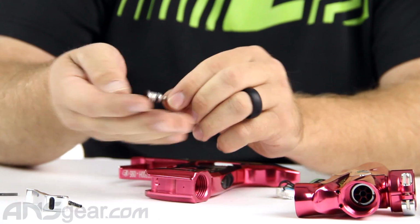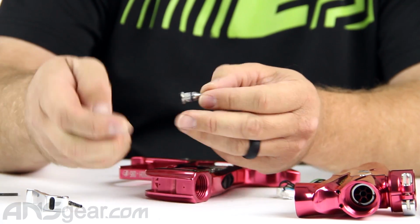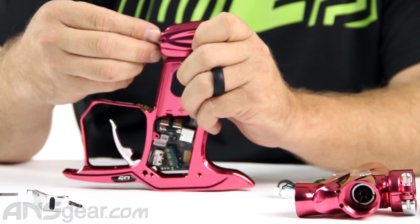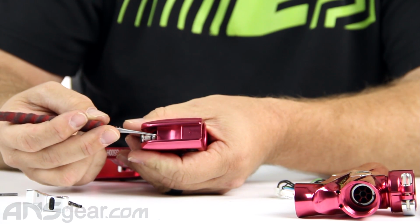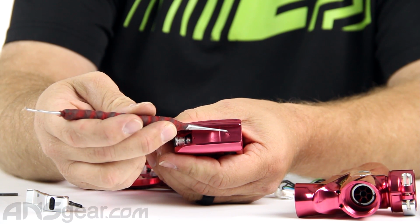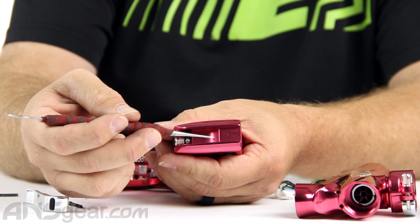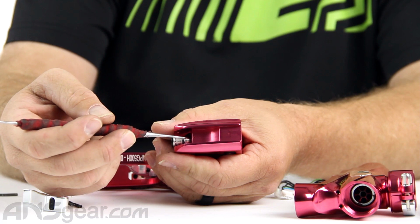That comes out. This O-ring that's on this plunger right here, these go bad. I've seen plenty of them break, but they're very simple to replace. And if you get a leak coming out the bottom of your ASA that is not from the back side right here, you can see that there's two holes. There's one tiny little hole there, and then there's one hole somewhere right there. If this one is leaking, that is the O-ring on your tank. If this one up here is leaking, it is the O-ring that is on this plunger right here.